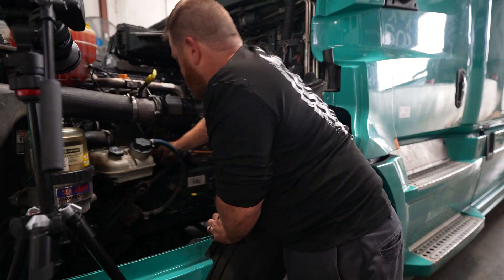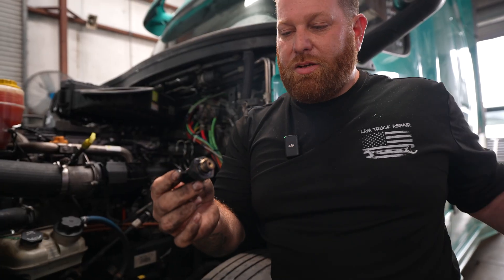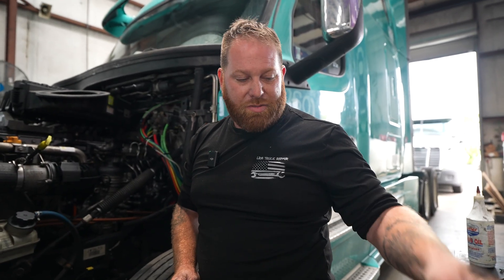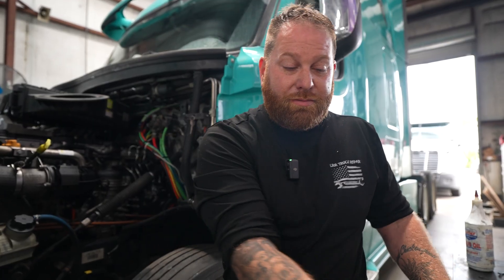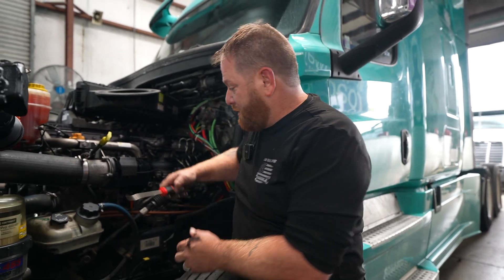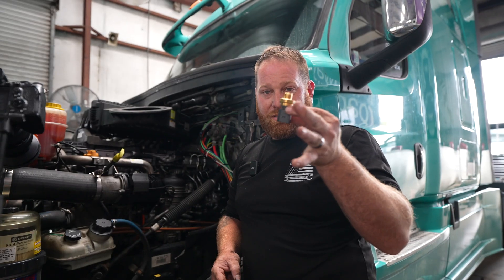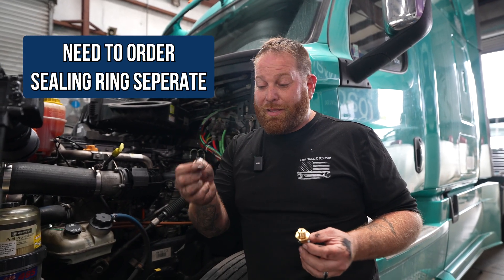Move that out of the way, get my hand in there — and there you go: your nice oily-looking oil pressure sensor. Now, when you do these, there's always a little sealing ring. Sometimes it stays on the block. Some people like to use the old one — I don't. You can use your pick to fish it out, or put your finger on it and rub hard. I normally just put the pick on it and move it around the side. If it falls on the ground, it's fine — it's not a big deal since you're replacing it. Keep this in mind: when you buy the sensor, it does not come with the sealing ring, so always remember to get the sealing ring with it.